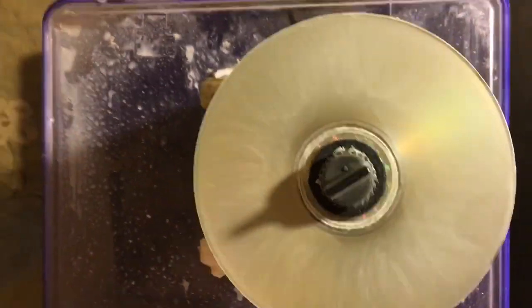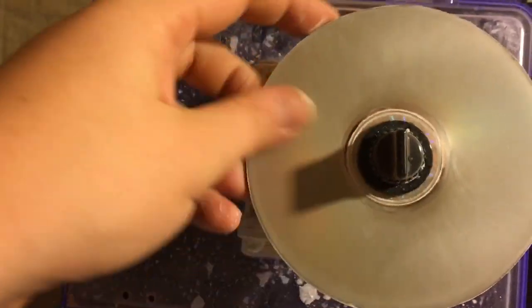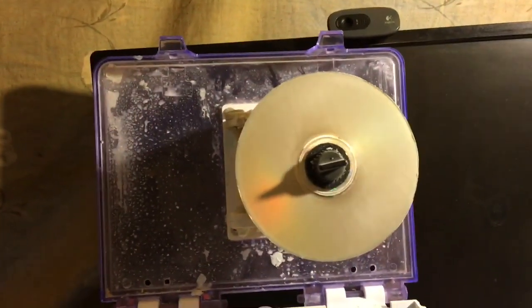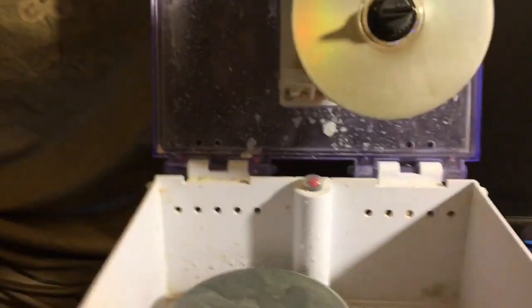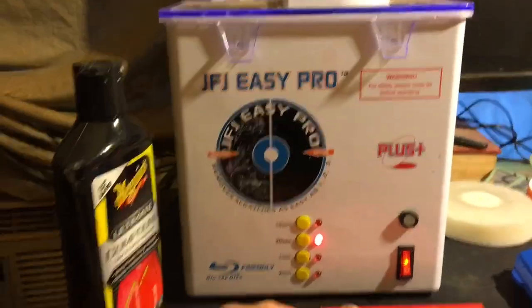It's not too hot because I sprayed it with water. Here is the other half of the disc. See this dust? Don't breathe it — preferably use a mask for this. What we'll do is take a cloth, clean that off, and then put in our other sandpaper — not the crap they sent us, but the Hercules sandpaper. This is 1200 grit. We'll soak that down with water and do the same thing. I've cleaned the sandpaper off so there are no large particulates on there. We're going to go ahead and do 20 seconds again because you do not go one minute.